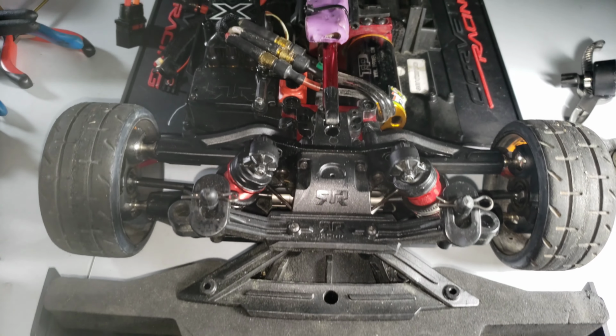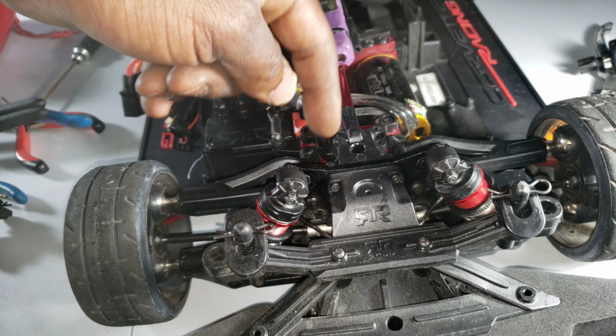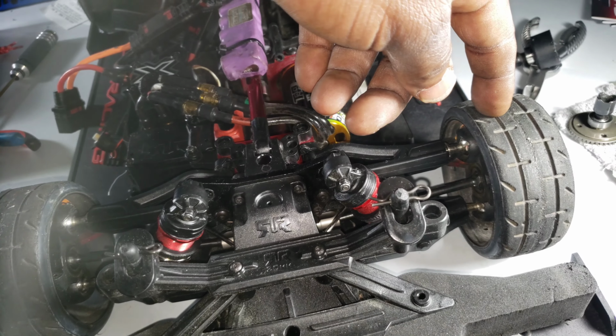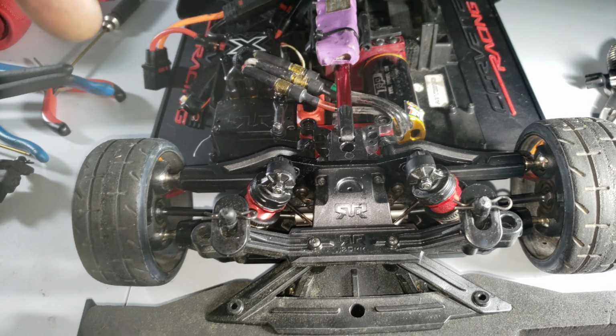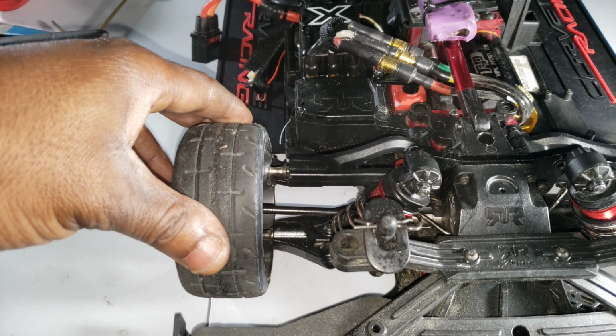Alright, y'all, I got everything buttoned up. Also, what I did was I moved my shock positions from the bottom up 1, and then I adjusted my wheels. I'll have a link below in the description on how I adjust my suspension. I've had a lot of people tell me they've gotten 5-mile-an-hour gains on speed runs on cars. I did it on front and rear. I just unscrewed this from the bottom and moved it to the top, and then adjusted my camber how I wanted it. And you'll see what I'm talking about through the video that I put down in the description.